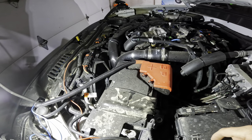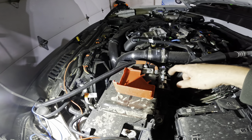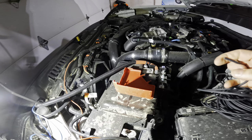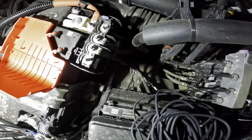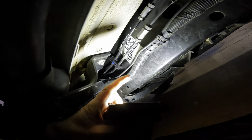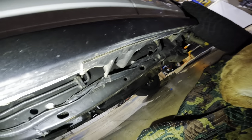So we're under the hood. This is where you need the yellow fuse holder to connect to. You can use any of these posts. Some don't come with a nut installed, so you have to run this black wire all the way from here to the back. You can see the large wiring harness right here — it actually runs down along the frame rail. You can see the wire loom that runs all the way back, and that is what we're going to chase.